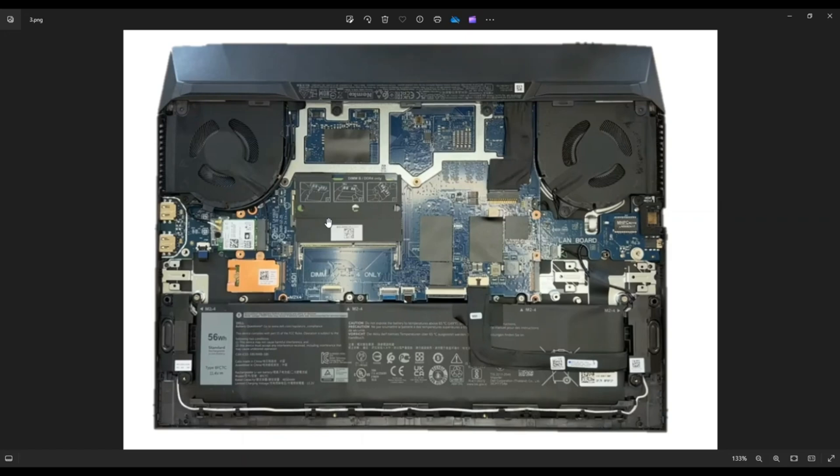Below in the description in that link with all the replacement parts, I'll include a single 16GB stick if you're looking to replace one that failed, and I'll also include a 32GB kit — two 16GB sticks — if you want to max this out. Maxing out your RAM is probably one of the easiest and cheapest ways of improving a significant part of your computer's speed, so if you're not going to upgrade anything else, maxing out your RAM is always a good idea.